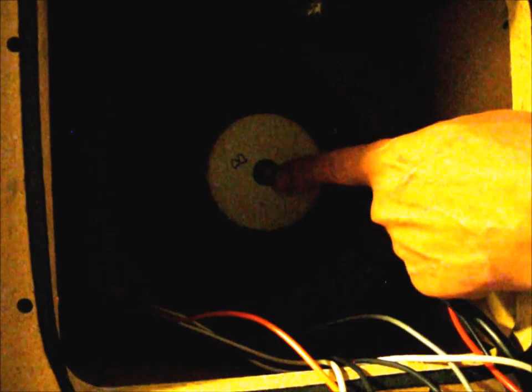KEF has an isolation system — there's a little rubber grommet on the frame to keep it isolated from the cabinet. Notice the bolt. Now let me show you where this bolt's going — come around the corner and look into the port. You can see that aluminum rod. There's another 8-inch woofer up in here and that aluminum rod connects them together. So we're going to have to pull the three nuts and then the center nut to remove this woofer.